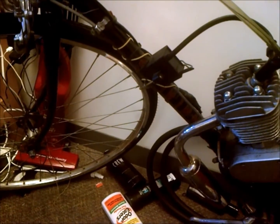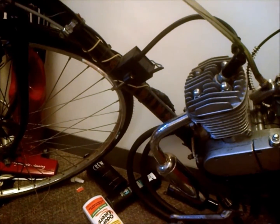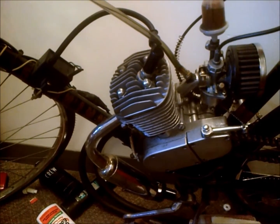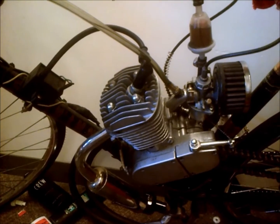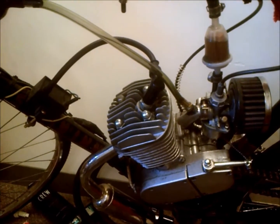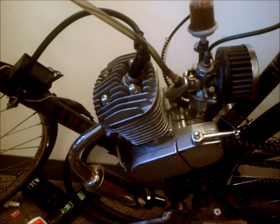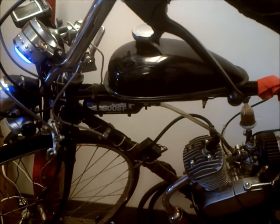I like to see when an engine is built somewhere between 180 to 200 PSI. At 180 you're still in 91, 92, or 93 octane territory — it's still pump premium friendly, so that's pretty good.